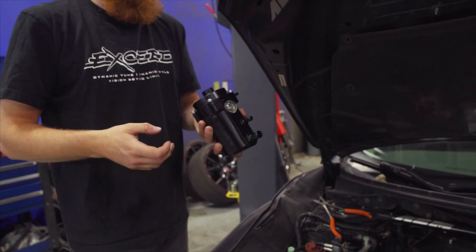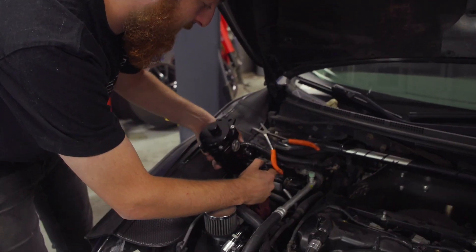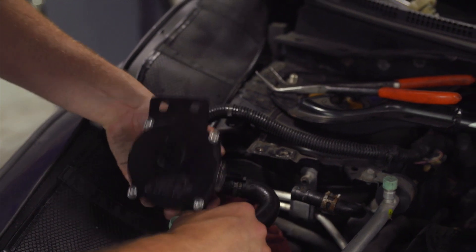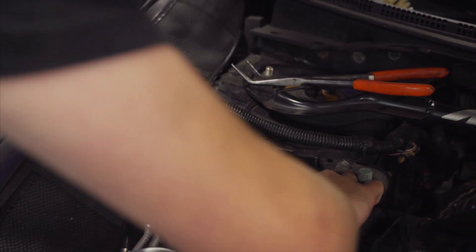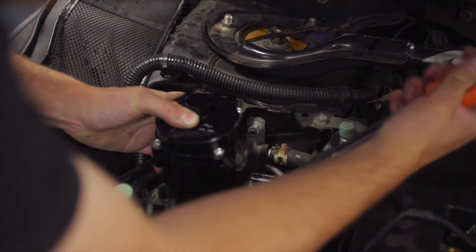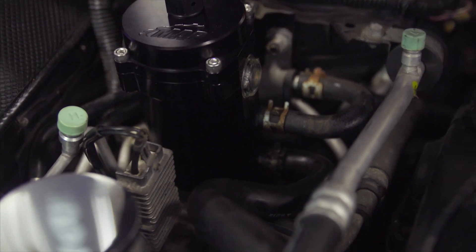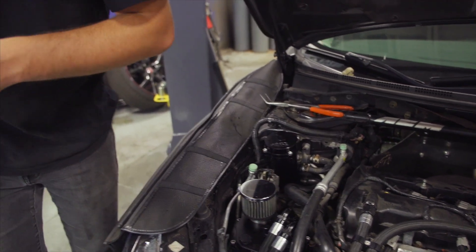Installing this is just as easy as uninstalling — it's the complete invert, as some might say. Start with the larger lower hose and slide that on. You may need to rotate the hose a little bit because the orientation is different when it's up here. Once you've got the spring clamp back on you can fasten it. Slide the upper hose back on. It's important that if you're reusing the spring clamps, you ensure they're in the same orientation as when you removed them — that's part of how they seal, and changing orientation may reduce clamping force.